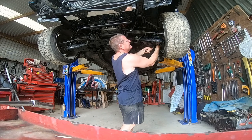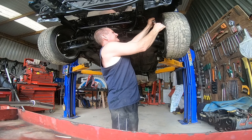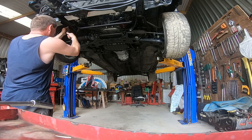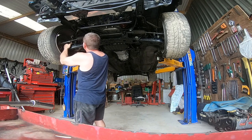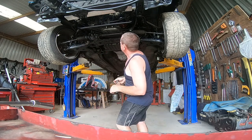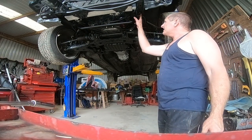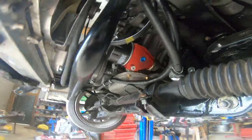I've come back to work and instead of just tidying up the shop after we destroyed it getting it running, I'm putting parts back in — things like putting a sway bar on. Because we've opted for my aftermarket oil filter housing, the sway bar clears perfectly. A front sump oil filter housing falls on the steering rack, and a rear sump one isn't too bad but you need to space the sway bar down. There's the sway bar in place — plenty of room.